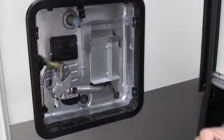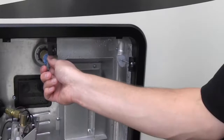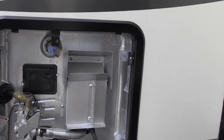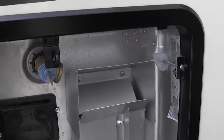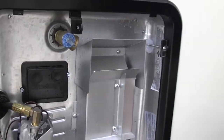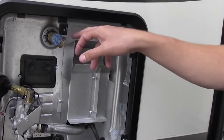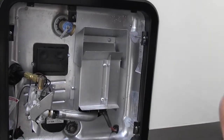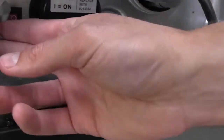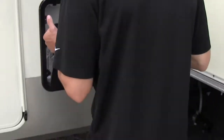It does have the bigger 10-gallon water heater here — it is going to be gas/electric. The first time you fill up your water heater after it's been winterized, pull this pressure release valve so it's straight out. If you're hooked to city water or fresh, it's going to start filling up. If you don't have that open, it's just going to be a vapor lock. Once water starts pouring out, go ahead and shut it, then you can light it up on gas or run it on electric. Right down here behind this little white piece of tape is the power button for the electric side — the gas side's on the inside, electric's out here.